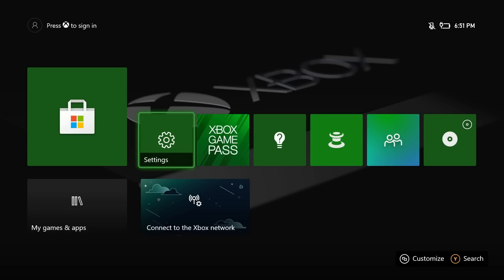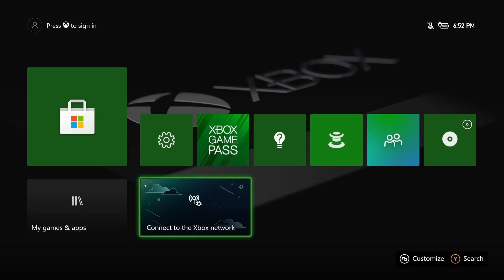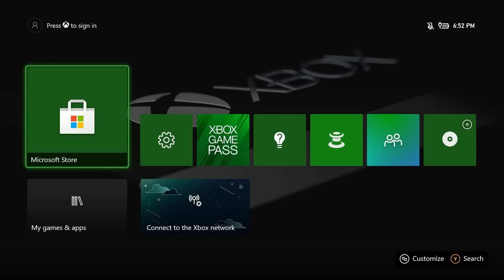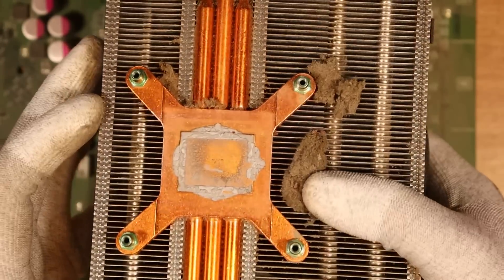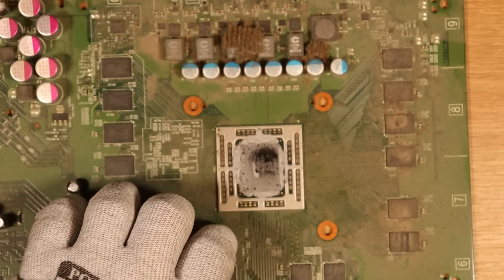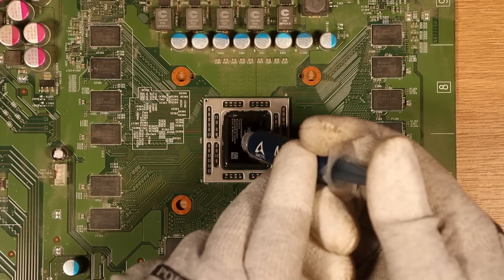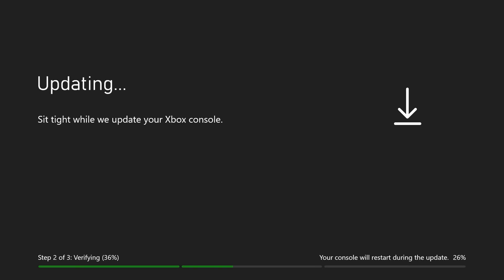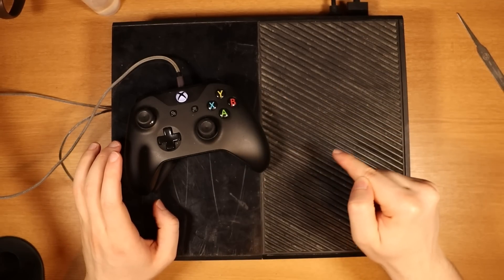The update seems to have worked. I've put a disc in and it's recognising it — just a DVD. I also need to reapply some thermal paste. As you can see, the thermal paste is very, very dry, with a couple of dust bunnies and non-existent thermal paste in places. Now to add the totally incorrect amount of thermal paste. This one I consider working — it's at 35-36% with a minor internet update to do. That's a fix. Let's move on to the next console.